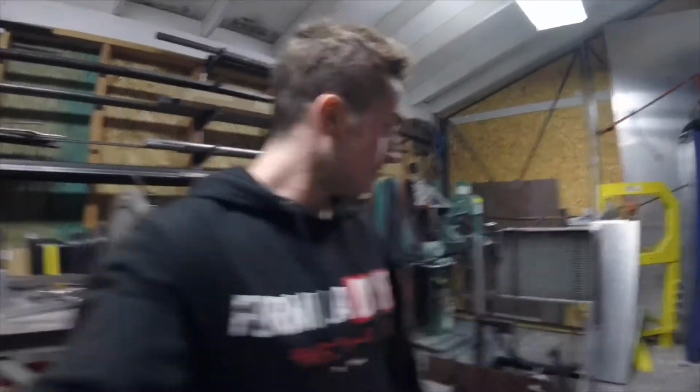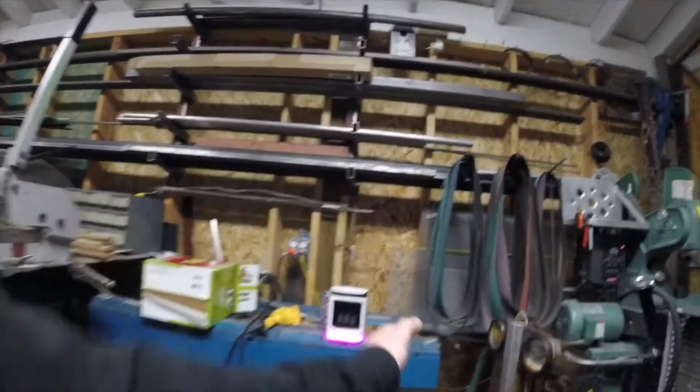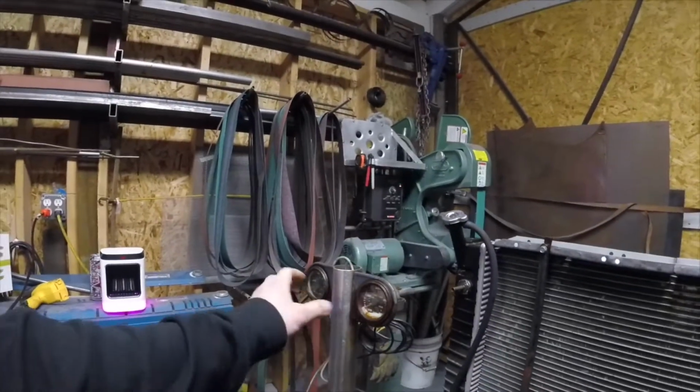So I'm gonna run my stand on this thing and get it dialed and make sure everything's good, no leaks, break it in, just check everything. I'm gonna have full readouts. This is not gonna stay here for long. Oil pressure, battery voltage, fuel pressure, all that. I'm gonna make sure it's good and dialed before I throw it in my car, because the 2J works awesome and the 1J is super super super nice and I don't want to mess it up.